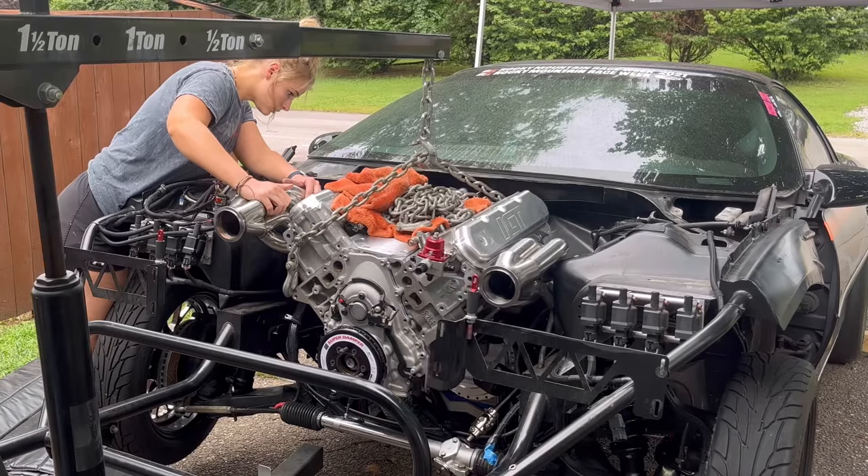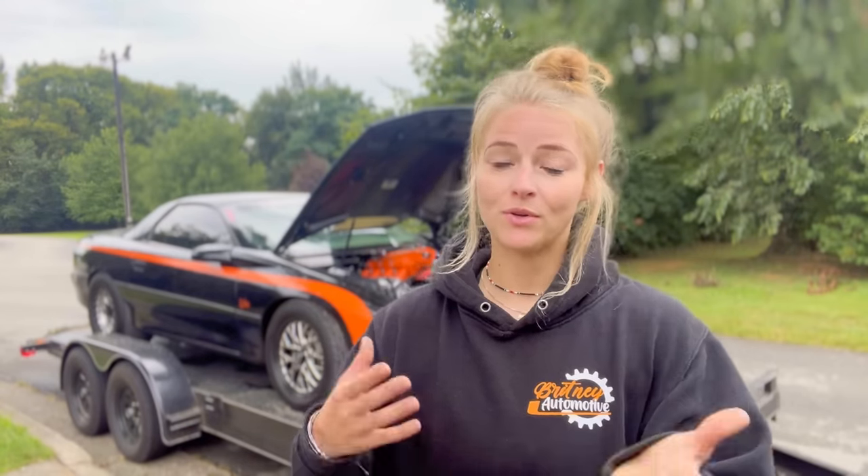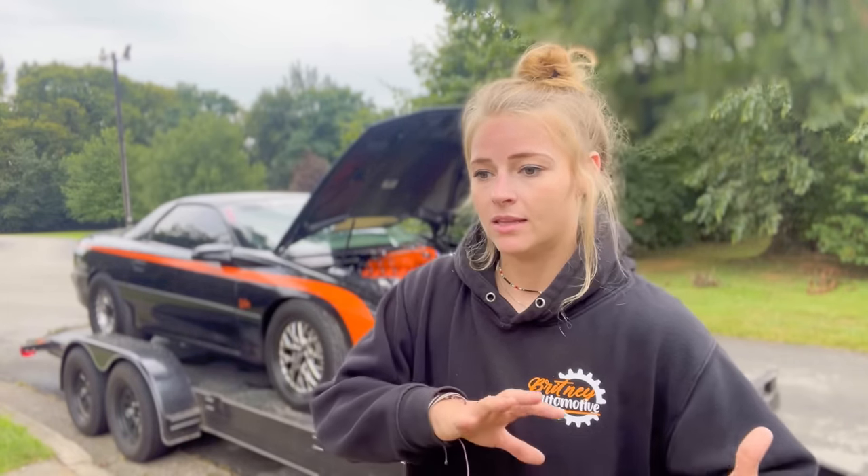The number one question I've gotten about this car is what headers I fit on here. I tried turbo headers with fender exits from Speed Engineering — I really wanted that look with the nitrous — but they fit on an LS and they don't fit on the Gen 5 LT1. We got lucky and found some Hooker shorties that actually fit; the link is in the description. From the shorties we used an LS swap exhaust — the kind you'd buy if you were putting an LS in this car. It didn't go in quite as seamlessly as I hoped, likely due to all the aftermarket parts already on the car. There was a lot of fabricating — basically tying the shorties into the exhaust with some tweaking in between — but other than that it worked great.